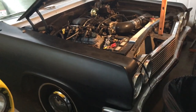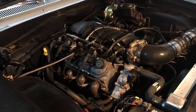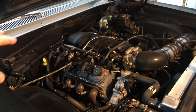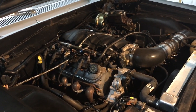This is my 1964 Chevy Impala convertible. As you can see, it has an LQ9 in it, which is essentially an LS3 now. It has a different intake, it's got L92 heads on it, so it's basically a 6-liter, high-compression, 10.5-to-1 engine.